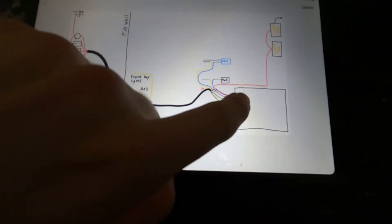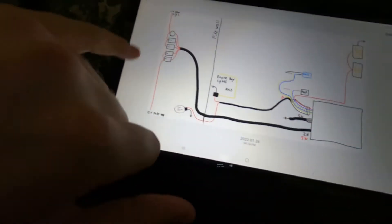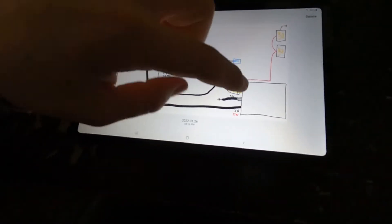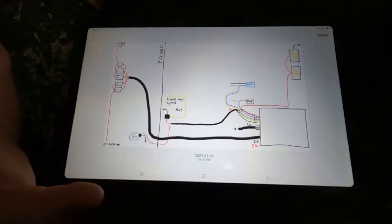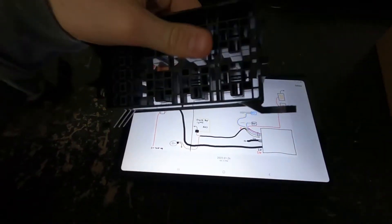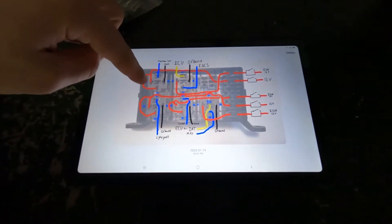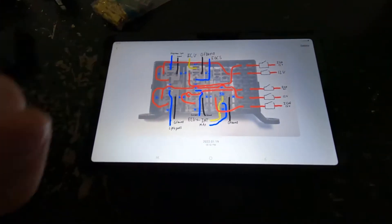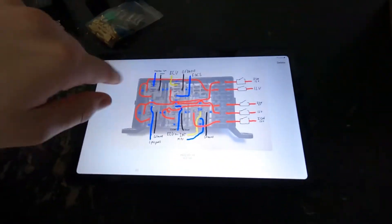And then this is kind of a wire routing diagram. Here's the relay box where it's going to mount right in the wheel well up at the front by the front bumper. Then I have the wires running in from the switch panel — I'm going to have some 12 volt ignition and some 12 volt constant running out into the relay box, ground coming out of the relay box, and all the sensor outputs coming out of the box going to their corresponding devices. So this is just the general guidelines I'm going to follow. What I want to do first is tie in all the wires that go from the power fuse to the relays, and also chain the grounds together so they come out as one ground wire.